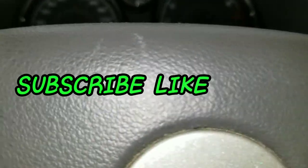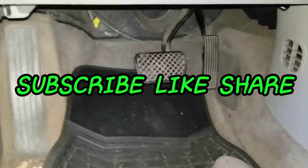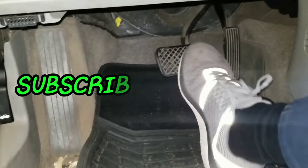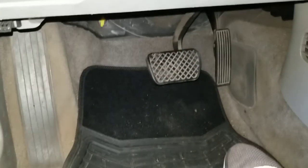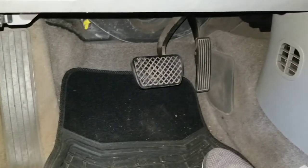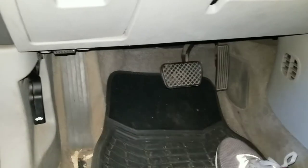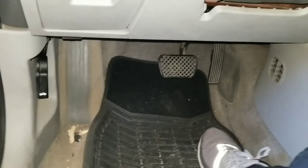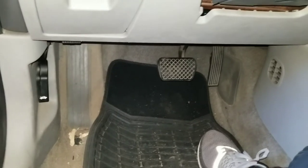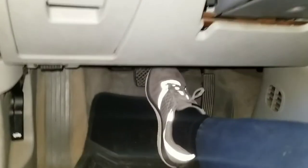What's up YouTube. I'm working on this Chevy Cobalt and the problem it's having is the brake pedal is very spongy - it's sinking all the way down to the floor with ease. When you try to stop you have no brakes at all; you have to pump the brakes quite a few times just to get it to stop. I got it running for a few minutes, turned the ignition off, and if I press on the pedal...